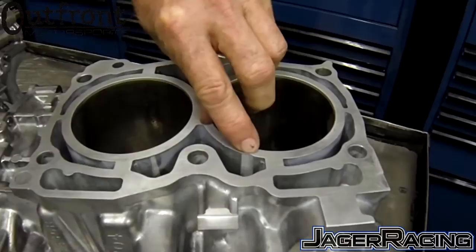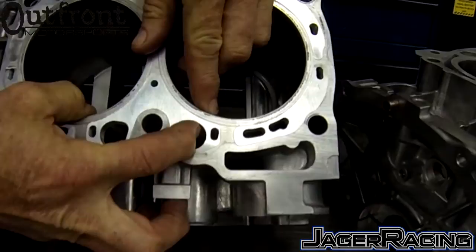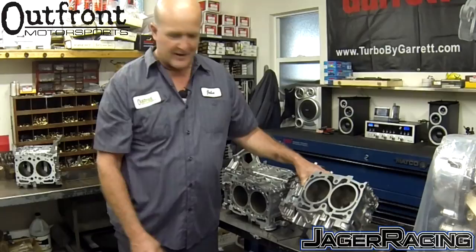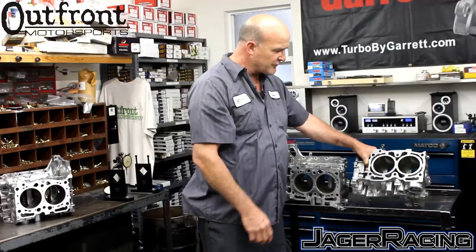Notice right here where it's been counter-relieved to install the case bolt and have room for a socket — this is the weak area. If you look at the insert, not machined of course, you can see the thickness of the backing of this particular insert, which stops this block from constantly trying to crack open during high cylinder pressure. If a cylinder were to crack, it always cracks at the 7:30 and 10:30 areas, right at these locations. So this is the area we're concentrating on the most.